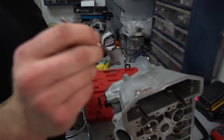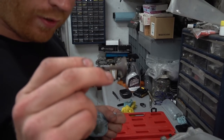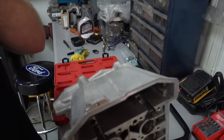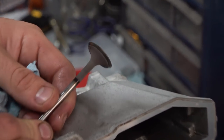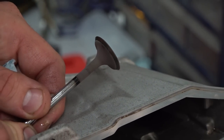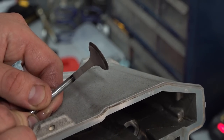So there we go. So that's an exhaust valve. Smaller one. See a little discoloration on it overall. Put it on top of the head so we can see it. Looks pretty good. I'm gonna zoom in on it for the people now that we have a better camera. Pretty cool looking. Yeah, so that's white and kind of gray due to probably some of that E85. Yep, so we'll clean that off.